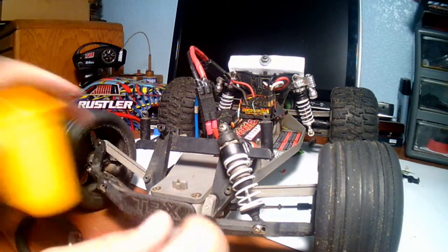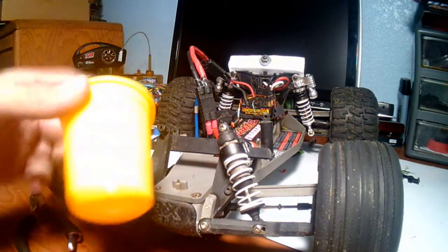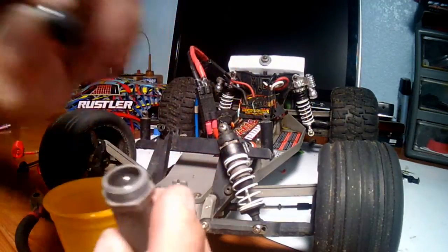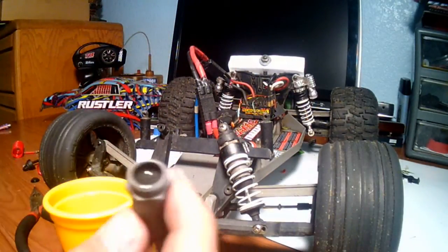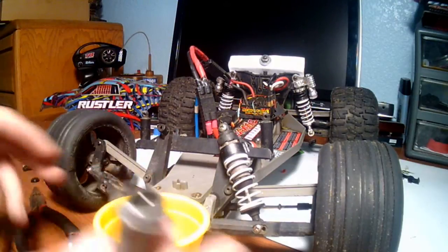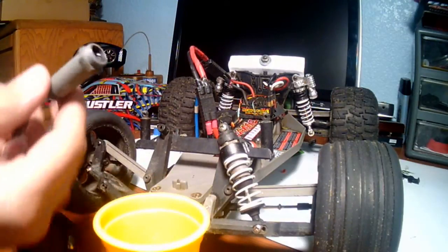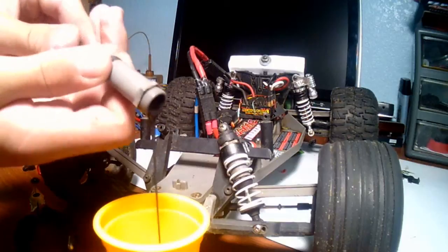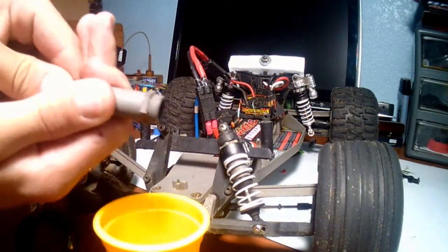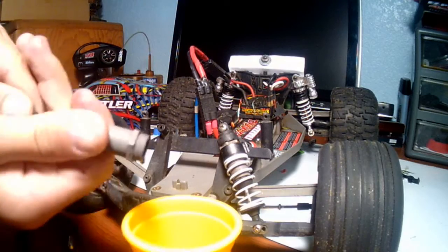Find a little container. Take the shock cap off — you can tell the oil is bad in here, it's been used a lot. I'm going to pour it into the container to show you the quality of the oil. If it's black and grey, it means the oil has been used a long time and hasn't been replaced.